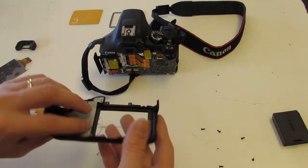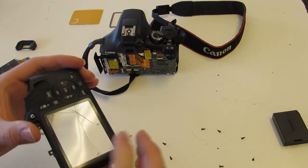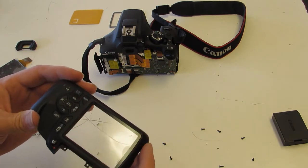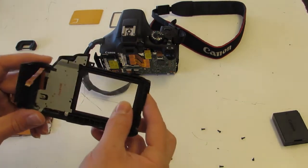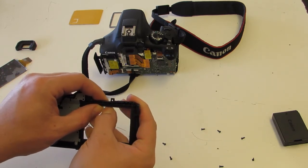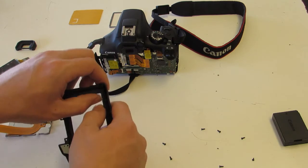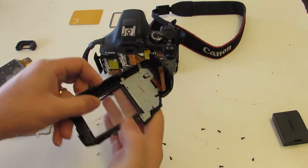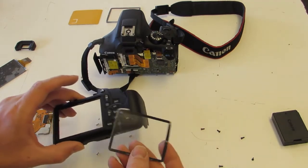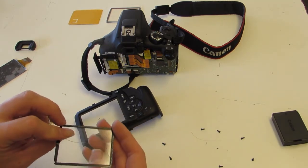Now for the rear piece of plastic. You could use a heat gun to warm it up if you were just replacing this without replacing the whole assembly — that would be significantly harder from the outside. Doing it from the inside is actually really easy because you can just push out on the plastic. Don't push out all at once in one place really hard; just give it gentle pressure and the glue should just let go.